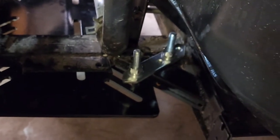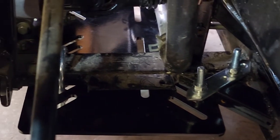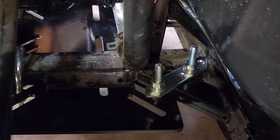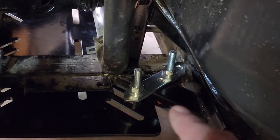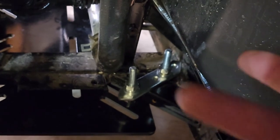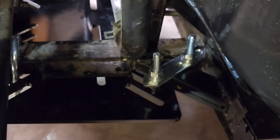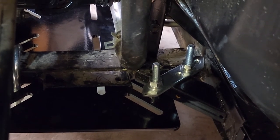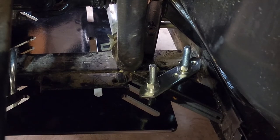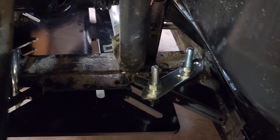That's it for T-Boss 550 specific stuff. Recap: take off your factory little plastic skid plate, short round U-bolts in the front, short square ones in the back — provided you do this method with another piece of steel there to act as a bracket. I want to touch on the Massimo community, which seems to be pretty good so far.